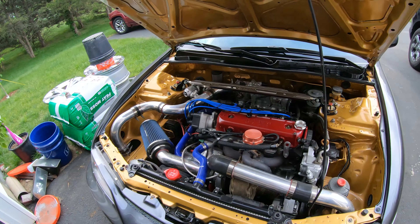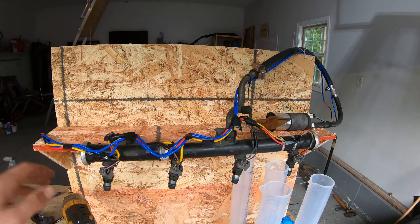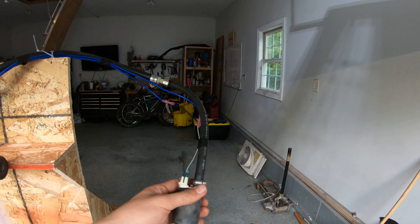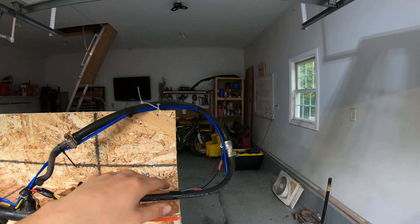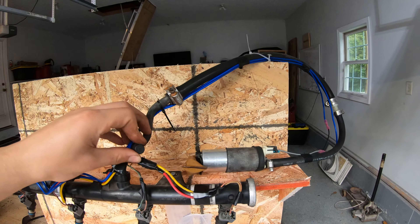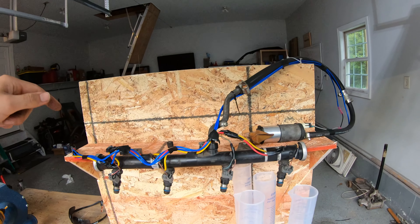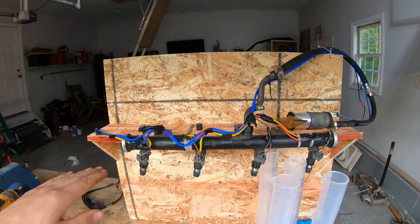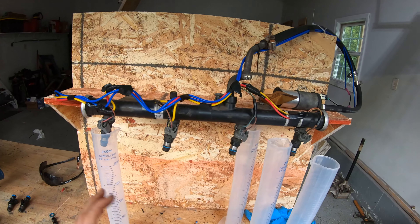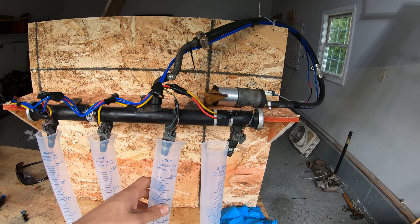I'm taking a break while the igniter comes in and working on some LS stuff. I made this injector flow testing rig — I have a fuel pump wired to a switch, running into a gas tank on the side of the table. It'll pump pressure into a line, and I have a test port on the feed rail for a pressure gauge. I want to see rail pressure, and I'm going to power this with a battery. I have a switch to turn on all the injectors at the same time and flow them into graduated cylinders.